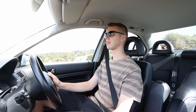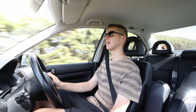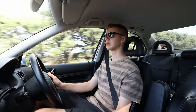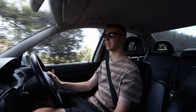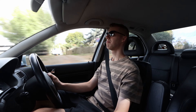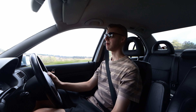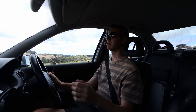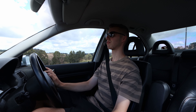Right now I actually think it's too soft, as silly as that sounds. Around my area there are pretty substantial bumps everywhere and I do find that I can bottom out quite occasionally. This won't happen if you're around the city sort of area, but on these rural country roads that are absolutely shocking, you do bottom out quite often due to how soft these coilovers are. I didn't experience this in my Audi at all with bigger wheels and smaller tires.